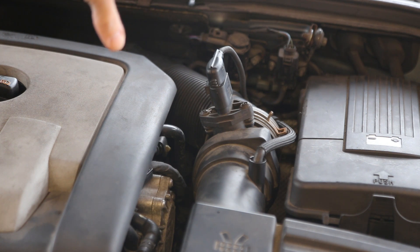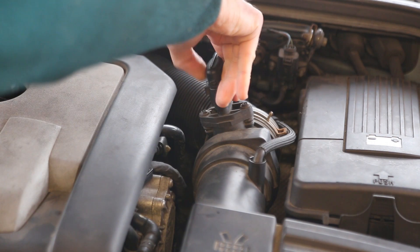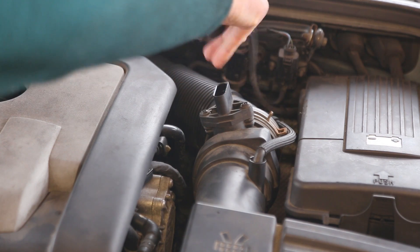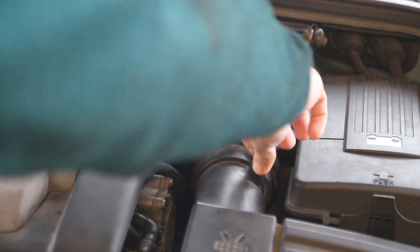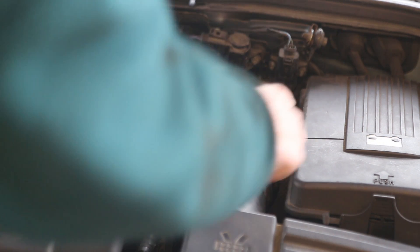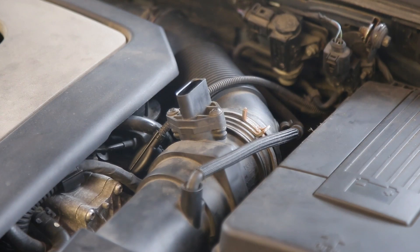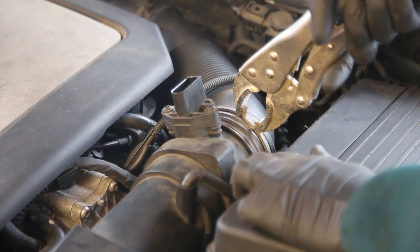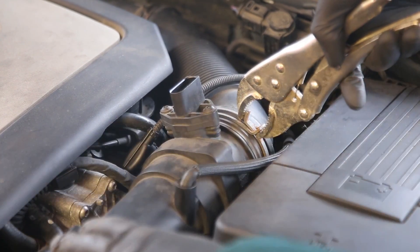The one on my car needs replacement. To replace it, first you have to remove the plug — pull on the tab towards the top of the plug and that will come off. Then the hose unclips, which literally just pulls off. Then we need some pliers to take the clip off here. I use mole grips, hold on, then move that to the side so the tube comes out.